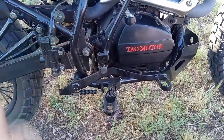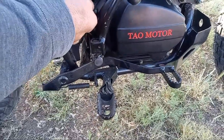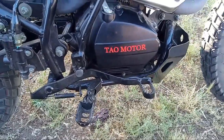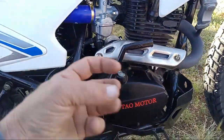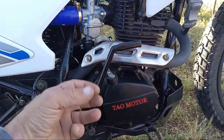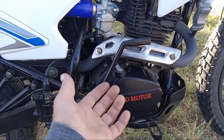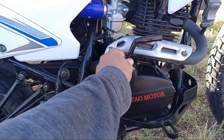I think maybe you might mess it up by running it on that oil. They say to change it, dude. It's called shipping oil. Do your research. Shipping oil is the lowest grade oil ever, and it's generally what they started the engine on, because they're going to throw it away. Little chips come off the perfectly machined engines when they run for the first time. There's little pieces of metal that come off, and then you want to drain that, and that's what the shipping oil is. It's only been run for a little bit.